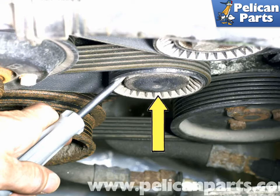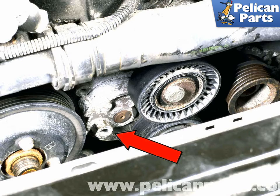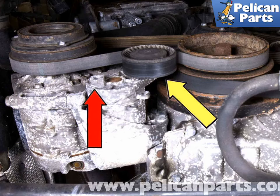For hydraulic style tensioners, remove the dust cap from the tensioner pulley. Once removed, you have access to the 8 millimeter allen bolt used to rotate the tensioner. Spring loaded tensioners use a 16 millimeter hex boss to rotate and release the tension. Locate the AC drive belt tensioner and use a 16 millimeter hex boss, or remove the dust cap to access the allen bolt if the hex boss is not present. Using a ratchet with a long handle and an 8 millimeter socket or a 16 millimeter open end wrench depending on the style of the tensioner, rotate the AC belt tensioner clockwise to release tension and slide the belt off the pulleys.